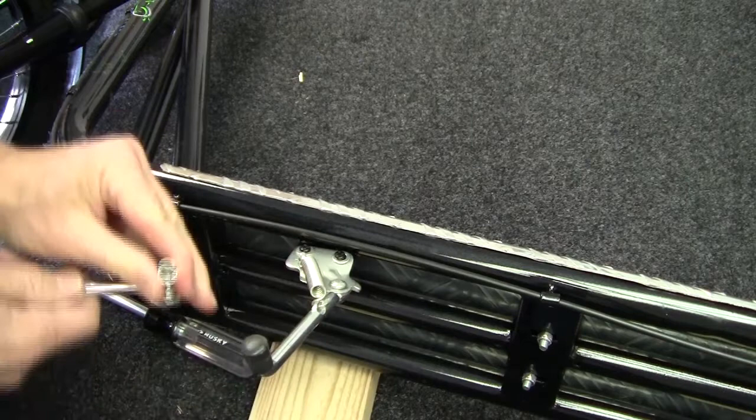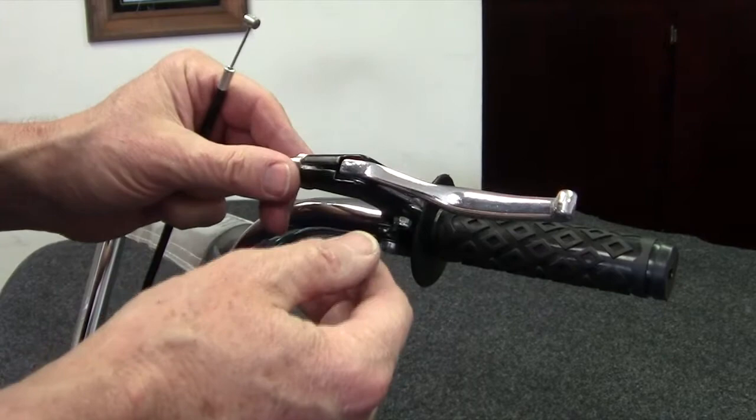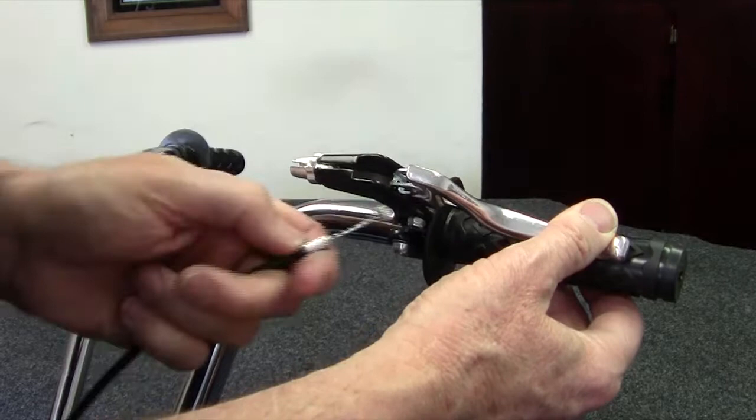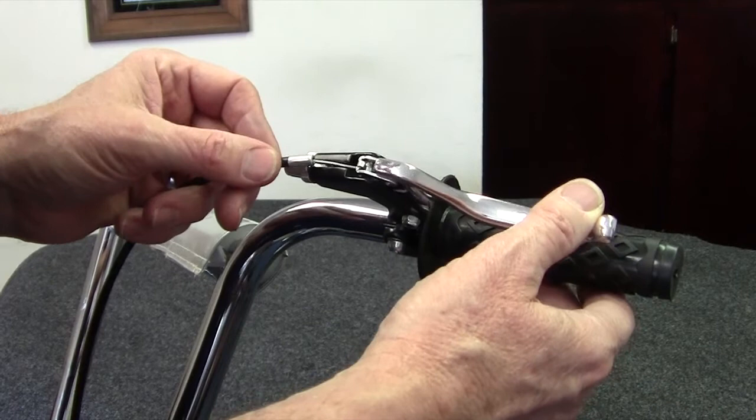The last item is to hook up the two brake lines. The cable from the rear wheel goes to the right lever; the cable from the front wheel goes to the left lever. Tilt the lever up a little bit and pull it in — there's a little pivot in there. Put the knob from the brake line up into that pivot. There's a little slot in the housing bracket, then just run the brake line through that little slot — you may have to compress it a little. And there your brake line is hooked up.